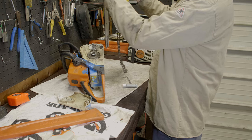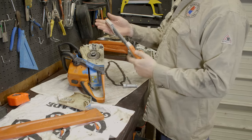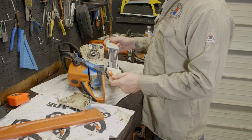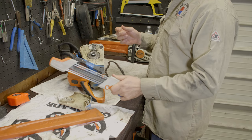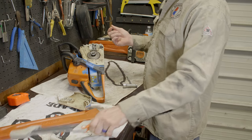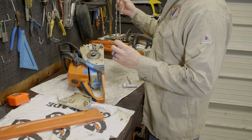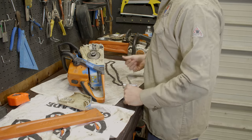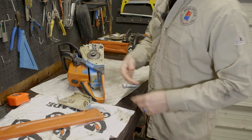Take your chain off. If you don't already have one of these electric sharpeners, you should go out and get one. They came out a few years ago and they're considerably better and more accurate than hand sharpening — I'd highly recommend it. For me, I've sharpened this chain about 10 times, my oiler's working great, but this chain still smokes when I try to cut through hardwood like ash. It's had its run — throw that one aside and get yourself a new chain.